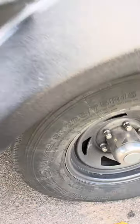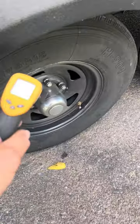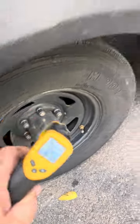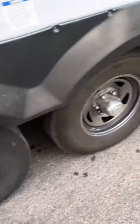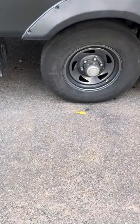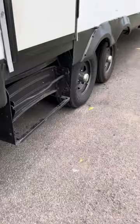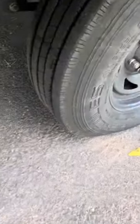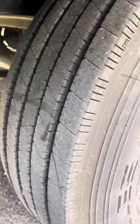This one's noticeably hot — you can feel it with your hands. But one of these IR thermometers costs like $15 to $20. This lets you check your tire temp, and you can also check down here to get an accurate idea of your bearing and brake temperatures. If you don't check those regularly, you won't know what they should be if there's a problem. So buy one of these, and check your tire temp and bearing temps every single stop. That way you can catch a problem like this maybe before it fails. We're probably going to get this one swapped out and maybe make another call to the Hercules Warranty Department to see if they'll give me any credit. Very disappointing for such an expensive, high-rated tire.